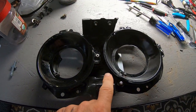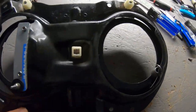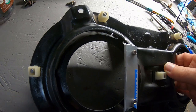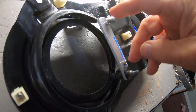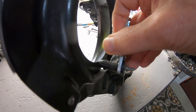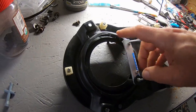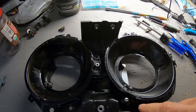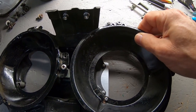Here's my modified headlight bucket fix. The original 520 spring for the 521 is pretty short and I don't have any more. So I just ran a piece of aluminum and bolted it down to the original holes so I don't have to modify the assembly. I ran a 3mm bolt with a piece of silicone hose and a little rubber washer, so now it's rubber-mounted - nice and tight but you can still move it up, down, left, right, and pivot on that bolt. No worrying about the headlight falling out.